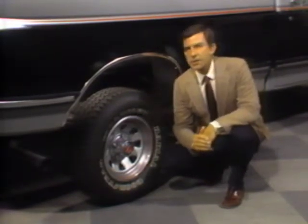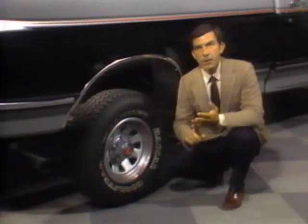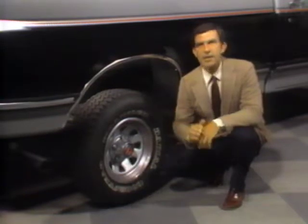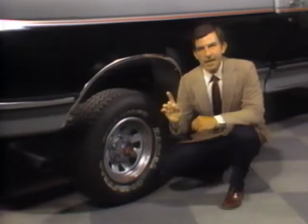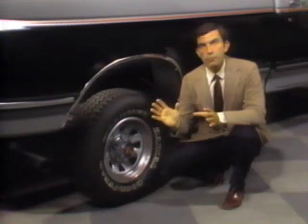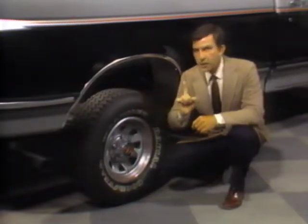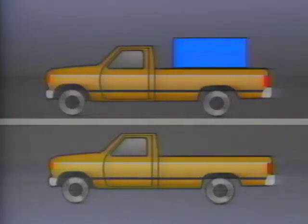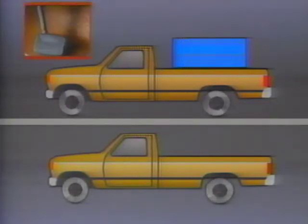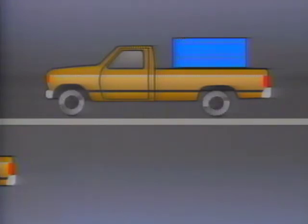And in back, there's another industry first for Ford. All F-Series pickups will feature a rear anti-lock brake system in 1987. The rear anti-lock brake system provides a fast-acting, modulated reduction in rear brake line pressure to inhibit complete rear wheel lockup, and in every instance, keeps the rear wheels from locking up prior to front wheels. This is particularly important in a pickup truck application because the differences between empty and loaded conditions significantly affect the load at the rear tires.